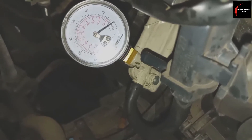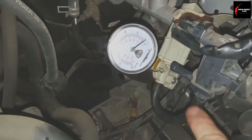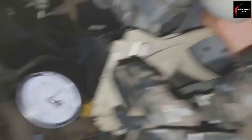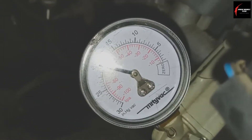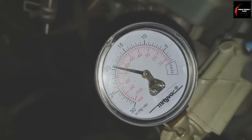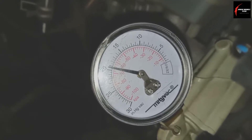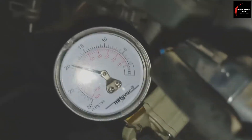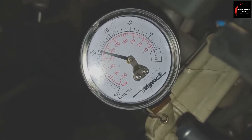Normal engine vacuum is somewhere between 15 and 20 inches of vacuum. I've got my Mighty Vac connected up to where the vacuum supply hose from the engine connects. You want to connect it here and then apply vacuum — I'm putting it to around 20 inches and then just watching it for a few minutes to make sure there's no decay. The computer is going to be watching this, and if there's even the tiniest drop in vacuum, it's going to pick up on it and trigger a fault code again for a leak detected in the EVAP system. If it doesn't drop within three to five minutes, that would suffice, and this canister purge valve would be in good working condition.